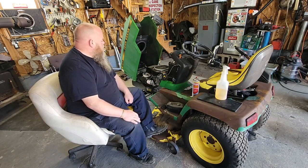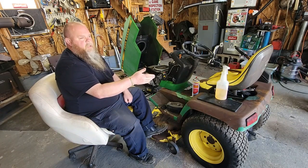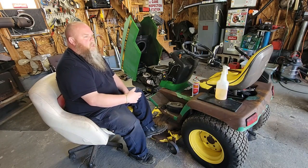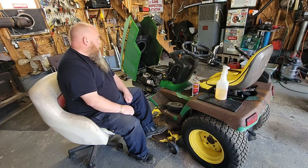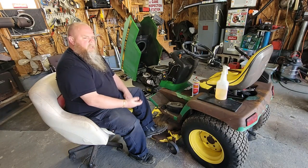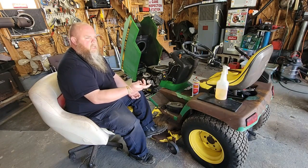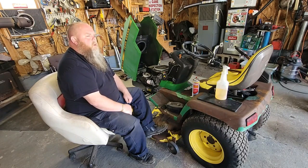I said, well, it seems like the gas in the tank is no good, it smelled real bad. So I pumped all that out and got fresh gas running through it. And all of a sudden, the thing fired up, sat there and idled. I couldn't believe it. You could just hit the key and start it up. So I was all happy about it.